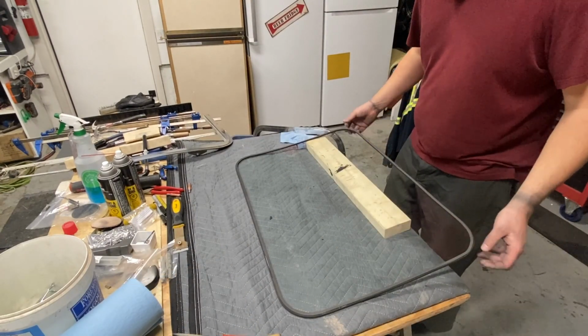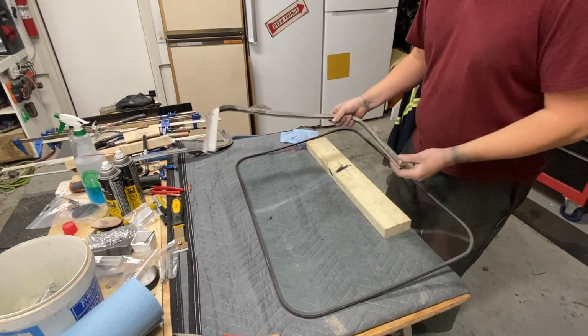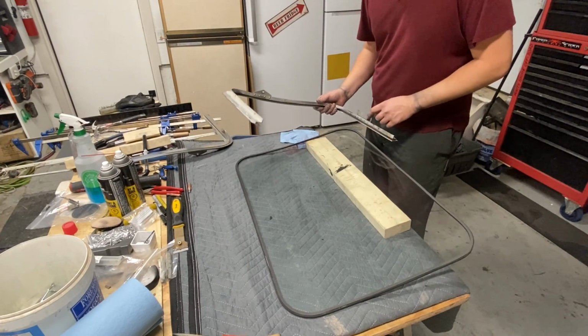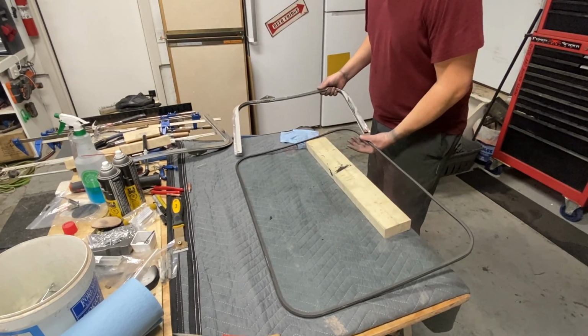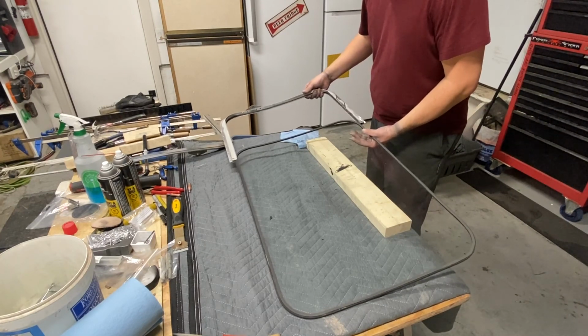This glazing gasket installed, we can go ahead and get these outer sash frames installed. So I'm keeping the splice of the glazing gasket at the bottom, so that matches up with the bottom latch location and the hinges at the top. So let's get this installed into the two sashes, and we'll get it riveted together.